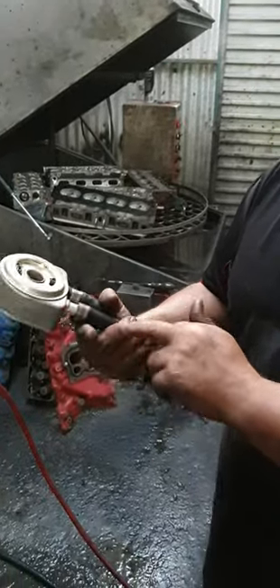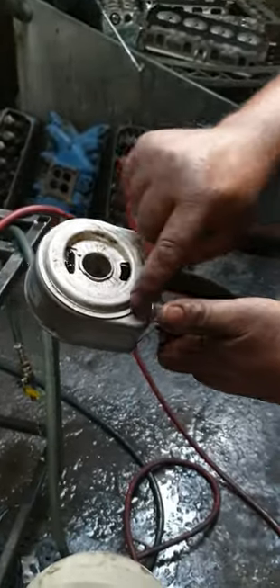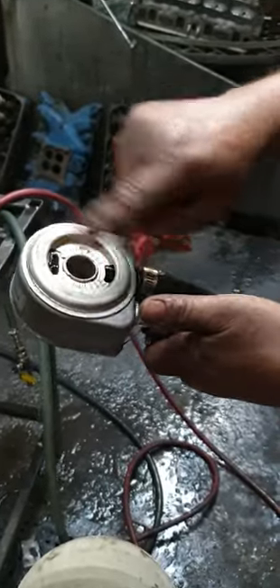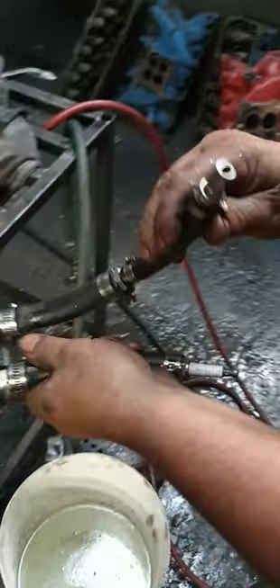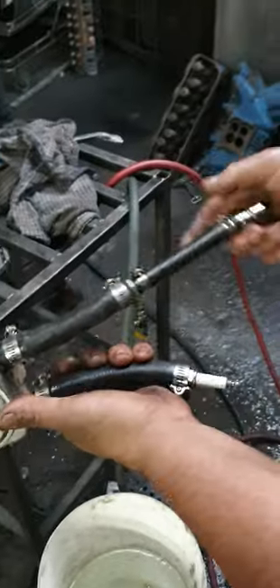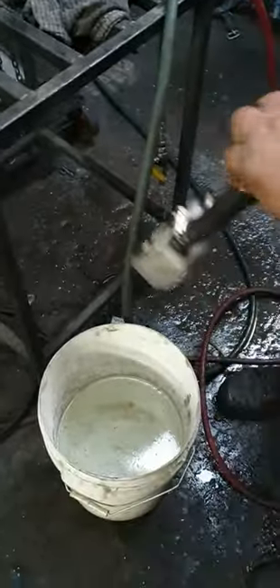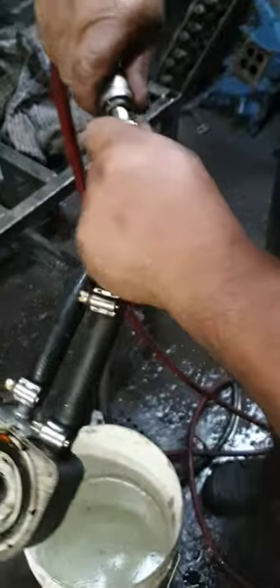So the test is pretty easy. Just block off — now this is where the water goes in. It goes inside and cools the oil inside, then comes back out again. So what you do, you block one end up. It's just a simple hose that I've made, and an air fitting on the other side. You fill up a bucket of water and just plug in your air from your compressor.